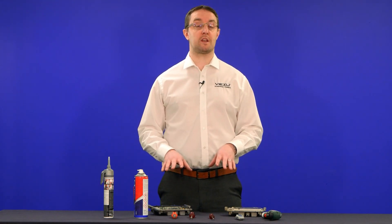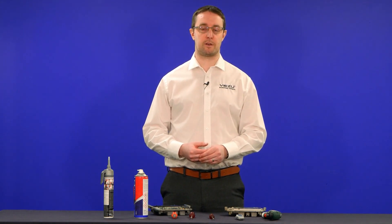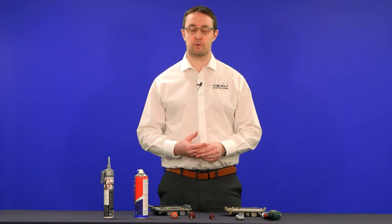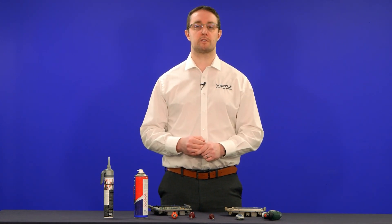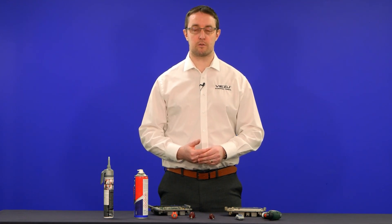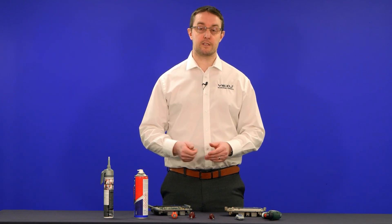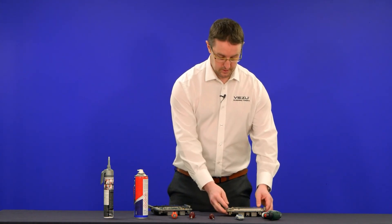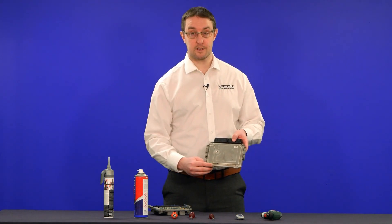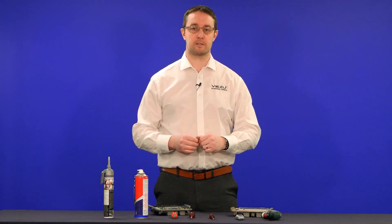There's a few bits of equipment we're going to need generally for most ECUs, and it will vary from ECU manufacturer to ECU manufacturer. Sometimes a pair of pliers may be useful to help bend one of the tabs around to reseal an ECU such as a SID 208, quite often found on the Siemens ECUs, things like PCR 2.1s — instead of screwed-down lids, you'll have little tabs that bend around and clamp into place.